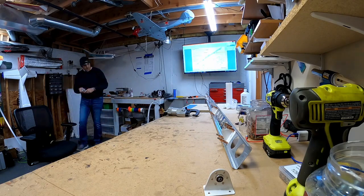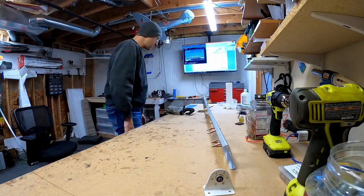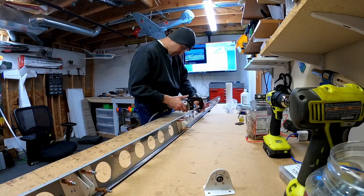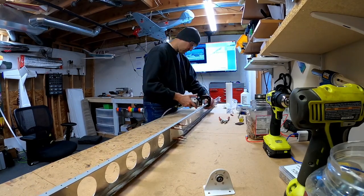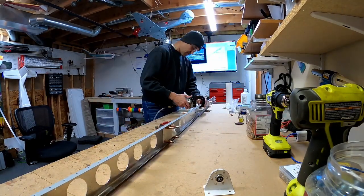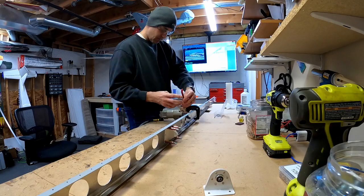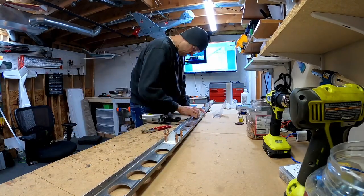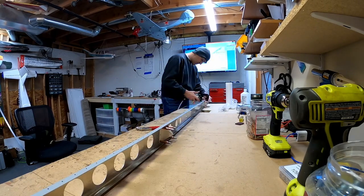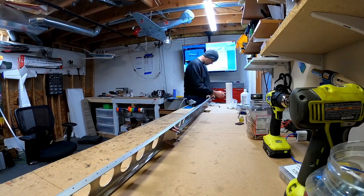Yeah, okay, so here's the next day. It is primed, and we start construction on the rear spar by basically just riveting on the doubler plate. And then we're going to go through and rivet on the attach brackets. And I think there's something we bolt on, because I remember going over some things with bolt torques and reading that and doing it wrong like twice and eventually getting it right. But nothing was over torqued, so I'm happy.